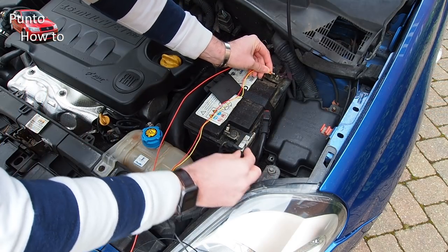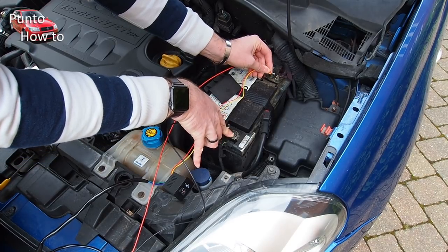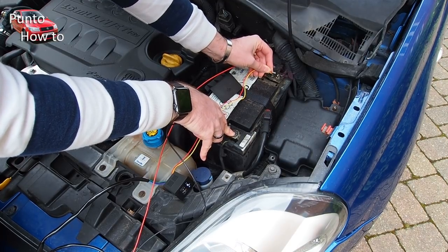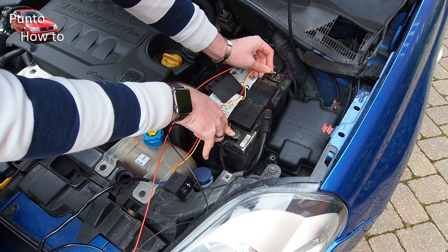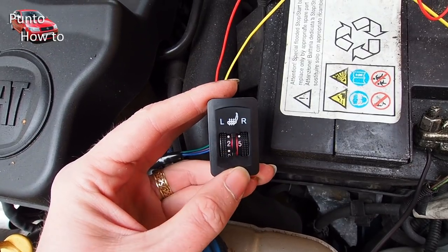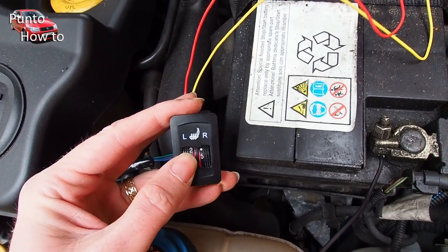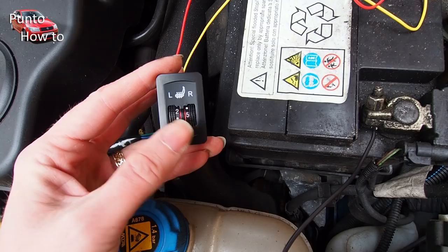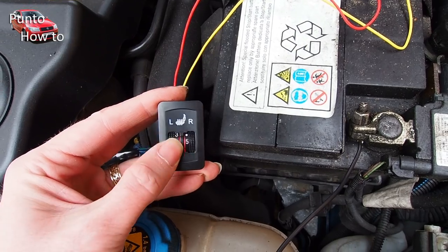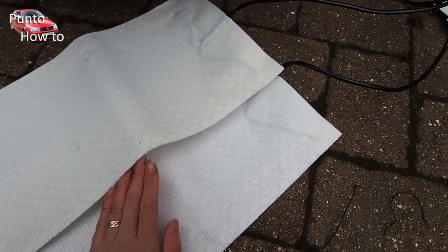The instructions for this set are quite poor, but essentially there are four wires: one earth, one main power wire that goes to the battery, and then two smaller wires that control lights to the actual control switch itself. I make these connections on the battery. With all the connections made we can look at the control switch itself. This is not like the original set that Fiat would install, which just has an on and off button for each seat — this has about five different settings and intermediate settings between those. We scroll the switch up and down to check that they all work, and then we check the heating pads are getting hot.